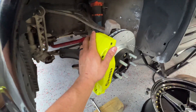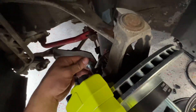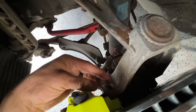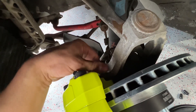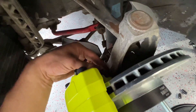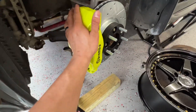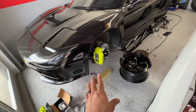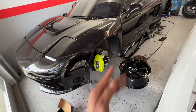It is pretty simple — not rocket science. You put the shims on, then the rotor, and then you bolt it up. There are going to be 17-millimeter bolts in the back — it just goes and bolts up. There's no need to drill out the spindles or do anything else. The brake pads will also come with the kit. This is a TLS big brake kit that I machined and modified with the shims to properly fit and center the rotor.